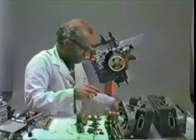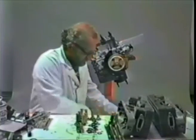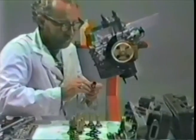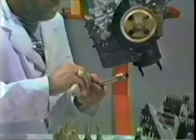Now we probably won't bore you with showing all 8 pushrod tubes here, but you get the general idea. It's a fairly simple, straightforward thing to do. It doesn't take much time. And the oil is used on the trapezoidal seals simply because it allows them to move around a bit inside. And when you do that, don't forget to expand the pushrod tube slightly here.